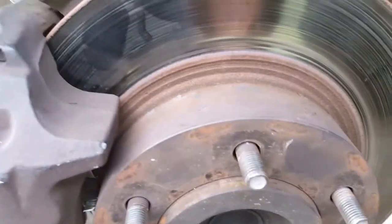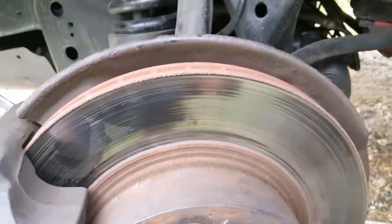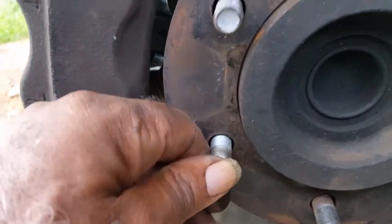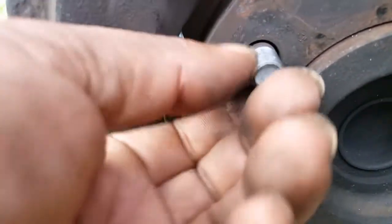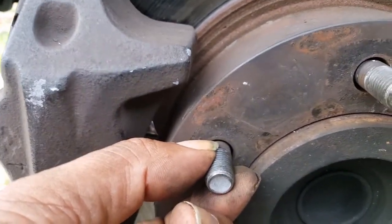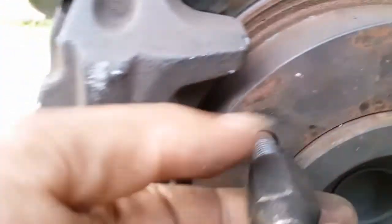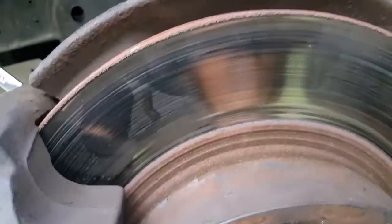To remove the bad wheel stud, you take a hammer and hit it. The wheel stud has splines which fits into the hole — you would hit it out. There is an opening at the bottom where you'll push the old wheel stud out and put in the new one. To get it flush, you'd use as many spacers as possible, or if you have a nut that fits, use that with the spacers, and once you tighten that it would bring in the wheel stud.